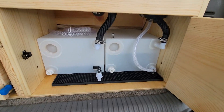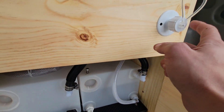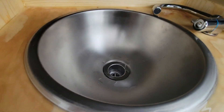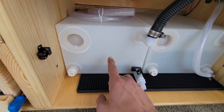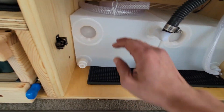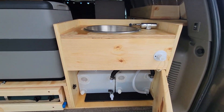Opening this cabinet, here you see two custom plastic containers — each one is five gallons. This is the fresh water container, filled via the fresh water outlet. And here's your five gallon gray water container — all the dirty water dispensed in the sink is collected here. We have a faucet to drain the water, plus a hose extension to allow you to drain outside the vehicle. That's pretty much the automated sink — a brand new design for the Suburban that I've never done before.